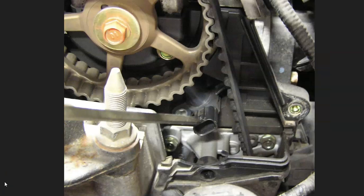If you check all that out and the wiring looks good with no blown fuses, it's very likely that sensor has just failed and needs to be replaced. The sensor itself is usually pretty easy to replace — it usually just has one or two bolts and a wiring harness — but sometimes it can be located in difficult spots. It's really going to vary depending on the engine and the year, so you have to check it out and see how difficult it is to get to.